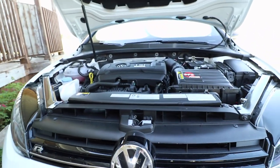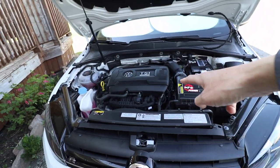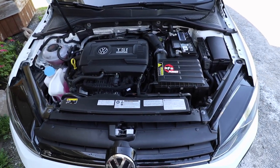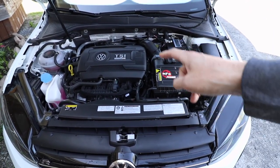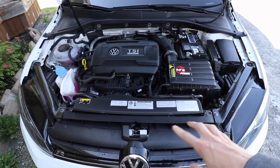I'm going to dremel this out and then we'll get a better ram air effect into the air box, and the better silicone hose — that will complete the air intake mod which gets you to around 97-98% of the best air intake you can get on the market by just doing those changes: high flow air filter, silicone hose, turbo inlet pipe, and this air plenum modification.